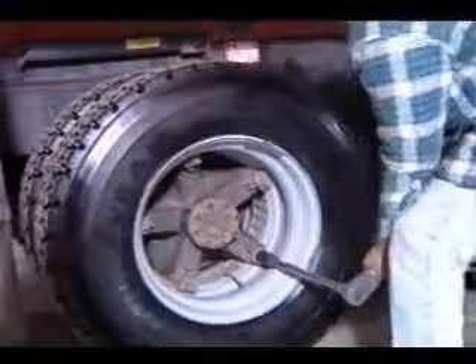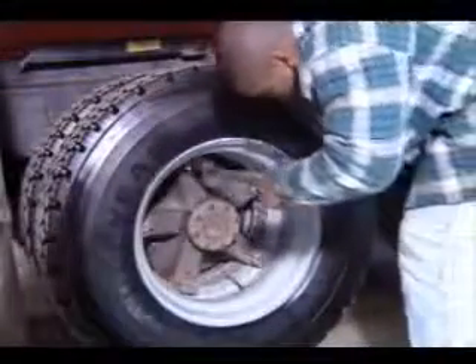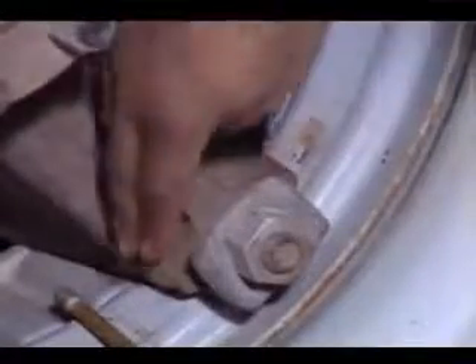While you're checking the rubber, you'll also want to look closely at the wheels. Check to see if the wheel lugs are tight, and if there is any indication that they have recently slipped. A bright mark to the side of each wheel lug is a good indication that the rim has spun. Some operators always center the valve stem between two lugs when mounting a wheel — then, by just looking at the stem location, you can quickly identify a rim that has spun.